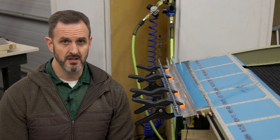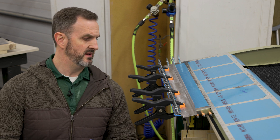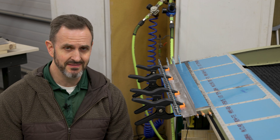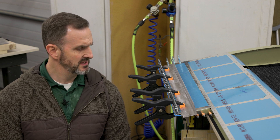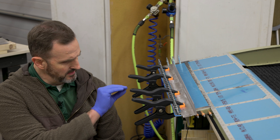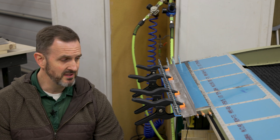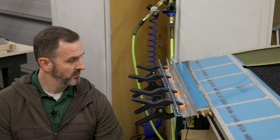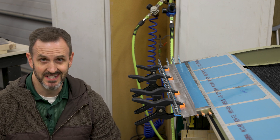That's pretty much it for the right elevator. I'm going to repeat the process for the left elevator. I think it went relatively smoothly. Dealing with that Pro Seal or tank sealant is kind of a pain - it's really thick and sticky. I'm not sure if I put too much in there or not enough. You're supposed to put a really thin coat; if it's too thick it can cause problems. I definitely don't think I put it on too thick, but maybe I did. Regardless, this thing's done, so hopefully it will cure all right and be nice and straight when I go to put the rivets in.